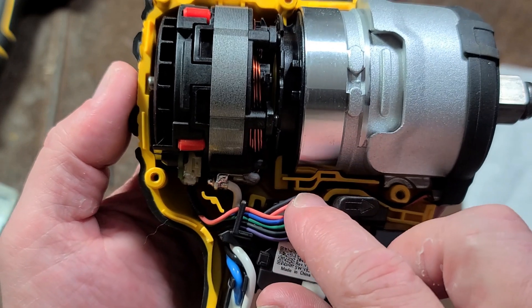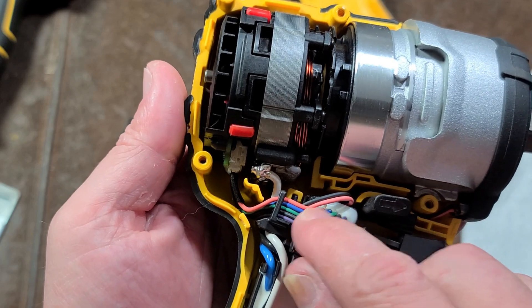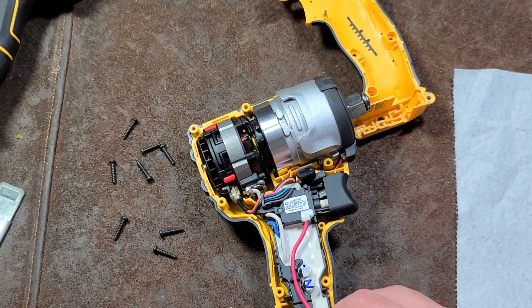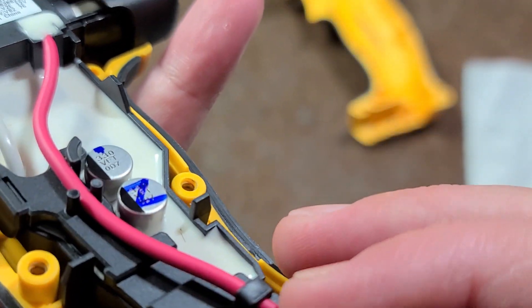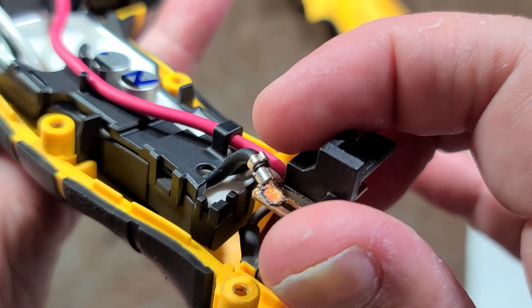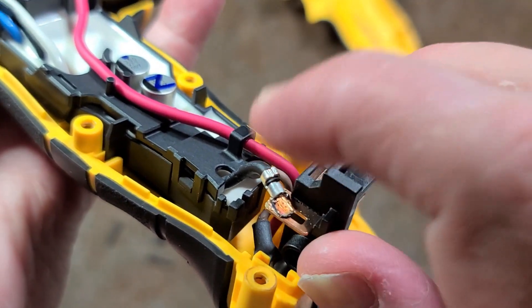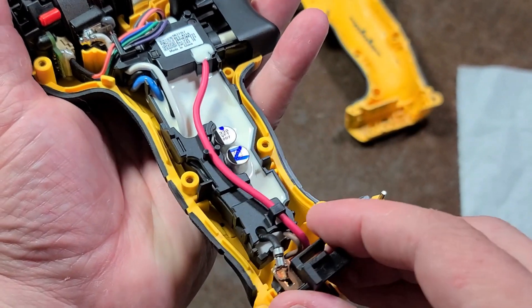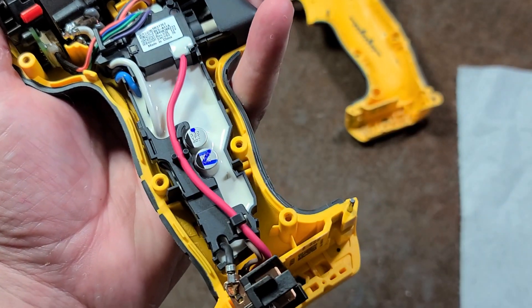The lights are on a little plug, a little socket. It's under these wires — always a hassle to get at. Down here they have pretty short wires, so maybe they're not so worried about it. They do have some strain relief, but it'd be nice to see some hot glue or something on there just to help reduce the chance of fatigue. A lot of cordless power tools, if they just stop working, the first place to check is whether you have wires that are fatigued right there at the battery connector.